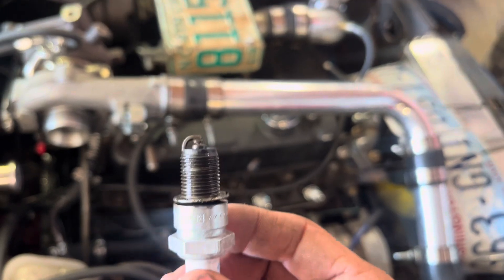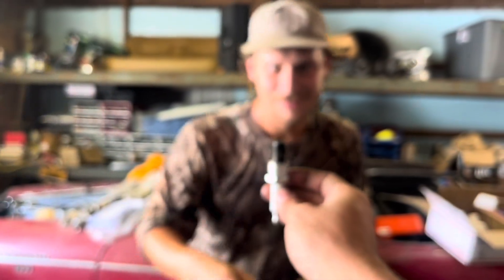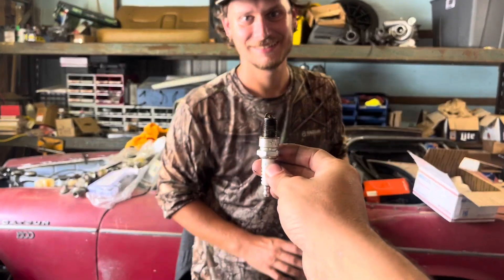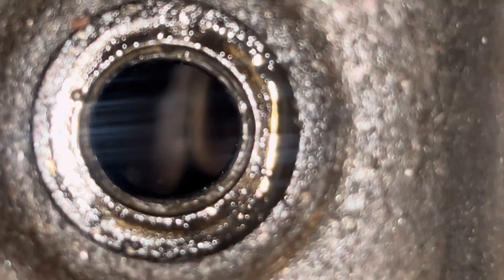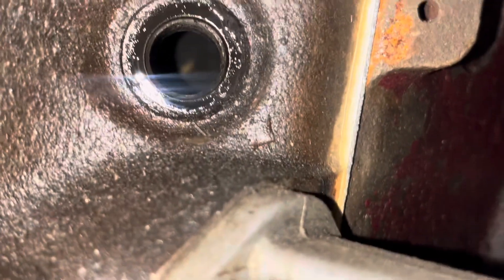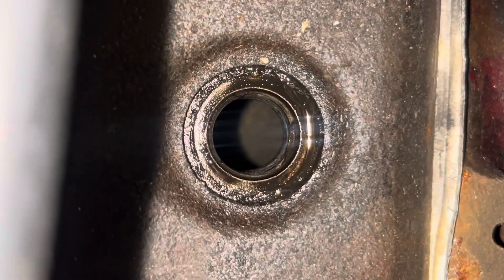This one's okay, not bad. Number four is good. This thing is soaked in coolant. Number two is also soaked, and number one is also soaked. Look at this gap — we gapped it way more than that. That has water in it. It looks fine... yeah, it's mainly number one. I think number two has some too.